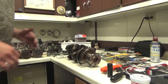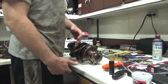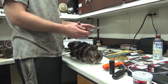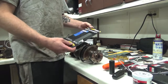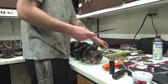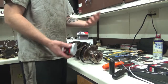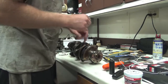The first thing we're going to do is show you how I polish cranks. You can bring it to the machine shop and pay like 60 to 100 bucks to polish your crank, but I like to do it by hand - I like my finish more than any machine shop finish. You're going to get a bunch of different grits of wet sandpaper because you'll be spraying this with WD-40. Start with 600 grit, move on to 1,000 grit, then 2,000 grit for finishing, and then some metal polish for a mirror finish shine.